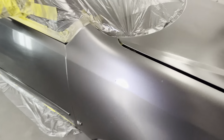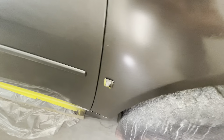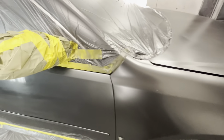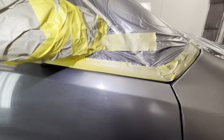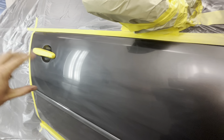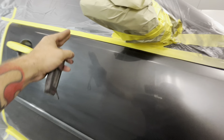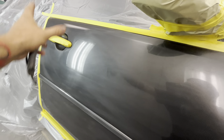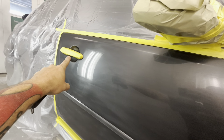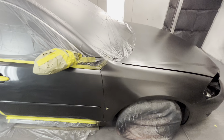Scratches are really hard to get to go away with just base coat — you've got to do primer work. But you can see on my tape that my color does not go very far at all. My color pretty much stops; I literally just flicked the paint gun off this panel and what dusted out, dusted out. There's no real color back there — all of that still matches the original, with just a little overspray right here. When we come in with our next color, we're going to purposely bring it to about where our overspray stops on the drop coat, let it flick out, dusting about center of the panel, and slowly transition into absolutely no paint. We want absolutely no paint on that far end so the door matches perfectly, and we want the color to fade so your eyes don't see it.